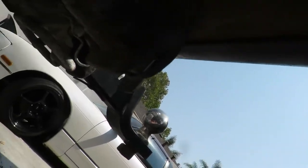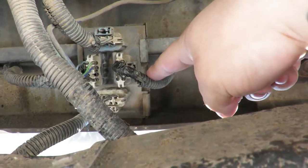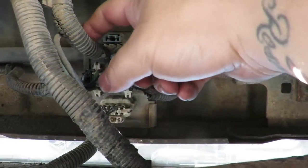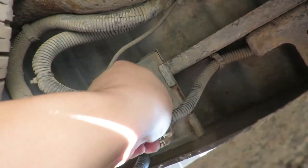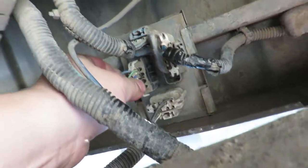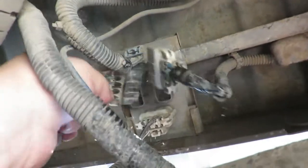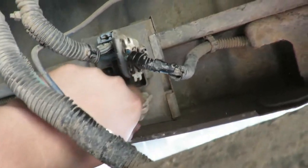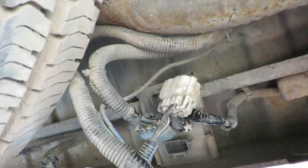Now we're under the bed of the truck on the backside. This little panel right here has all your connectors for the lights: your driver's side taillight, passenger side taillight, your license plate light, and one that comes from the computer. We're going to take off all four — they are simple push clips, so just grab them and pull off. If you feel like you won't remember, just put some tape and mark which side of the panel they're on. And there you go, all four are disconnected.